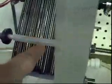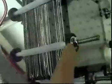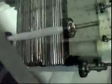This is simply just that rigid water hose that you can buy at Home Depot or anything like that, and works perfect to insulate any threaded rod. I use stainless steel threaded rod just for the simple reason of why not use something that won't rust. It just makes sense. And stainless steel nuts and washers, and they even have a rubber backing so that the metal doesn't push right against the acrylic, just so there's no cracking when I tighten them.